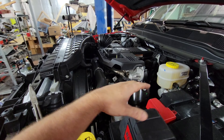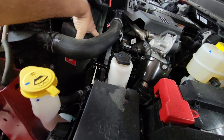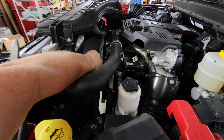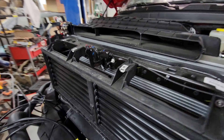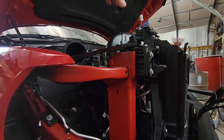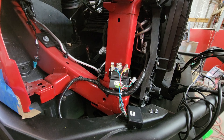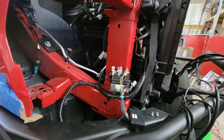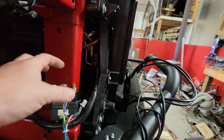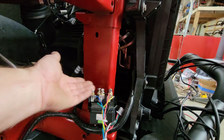There's just nowhere to put it. I could put it over here on top of the fuse panel, or try to finagle it down against the radiator, but that's not feasible. It doesn't need to be attached over here on the rubber housing for the fan shroud, so I can't justify that. What I ended up doing is — I had to pull the headlights out anyway doing some emergency light work — I disassembled this module. Warn doesn't say that you can do this, however the tech I talked to on the phone said it can be done. They just don't supply the stuff to do it because they haven't tested it, but it should work fine. This thing is normally mounted inside that housing on the winch and exposed to moisture, so it's actually a sealed unit.